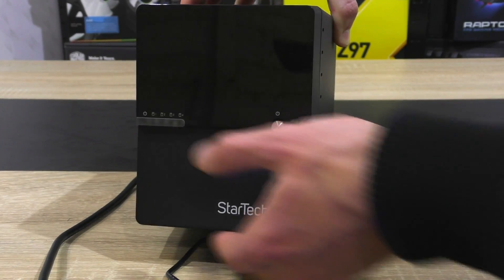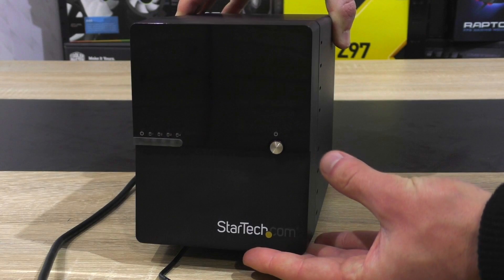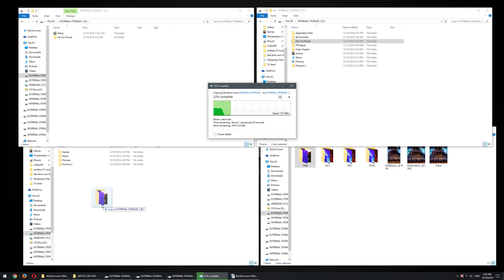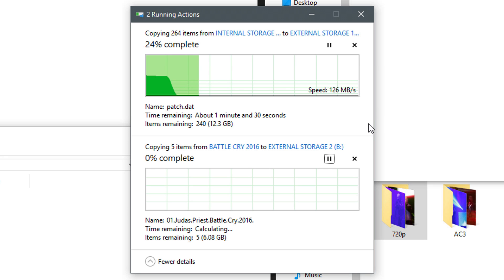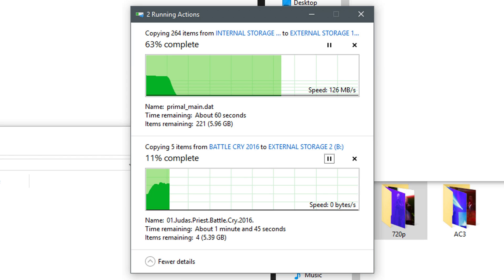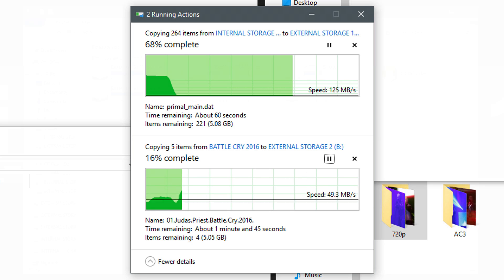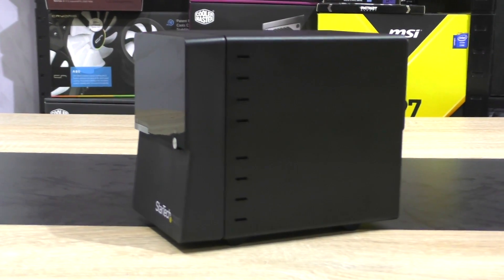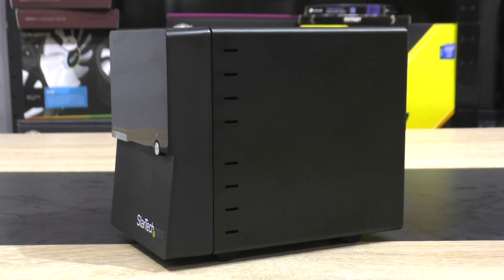A feature I'd really love to see is turning specific hard drives on individually — that unfortunately doesn't work, as with most enclosures. The transfer speeds are very fast over eSATA as well as USB 3.0, especially if UASP is supported by your system. When it comes to performance, I really can't complain. Please note that bandwidth is limited when transferring huge files from one hard drive to another while working on other projects at the same time, because all HDDs are connected via a single cable — be it USB 3.0 or eSATA. That's the worst-case scenario, however.